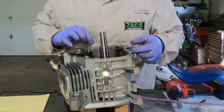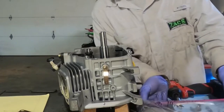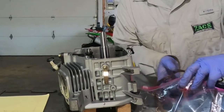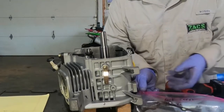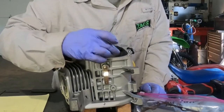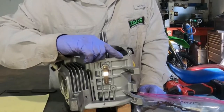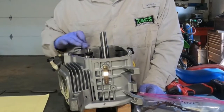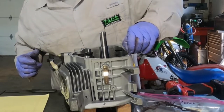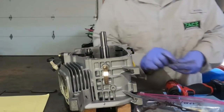I'm going to take the gasket off of here and very carefully put it back in. I would almost be surprised if that gasket does not leak — that's the thing about paper. I'm going to check into something else I'm seeing, because I know I did not pry right there with my tool. There is a dent right there in the face surface; everything else looks pretty fair. There is an indicator pin and an indicator pin — two of them — that goes with this case.